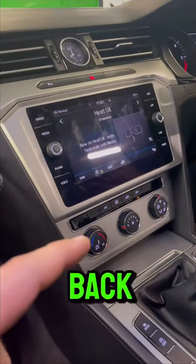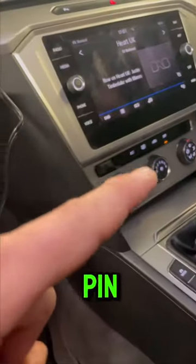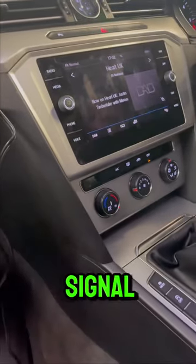We've checked the LIN bus coming out the back of this — 4.5 volts. We've unplugged the blower motor and we've unplugged the AC high-pressure sensor. We're still getting 4.5 volts. De-pinned the plug to the back of this and then we're getting 10 volts coming out of this, which indicates this is giving a good LIN bus and a good signal.